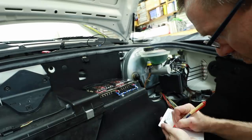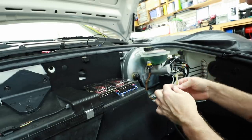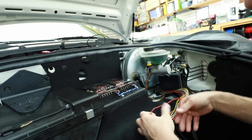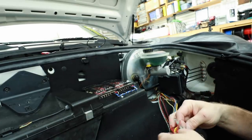Positive. That's the mid-range positive. How this is wired up: there's a fat gray and a skinny gray — that's the driver's door. There's a fat red and a skinny red — that's the passenger door. The rest of the wires are for the rear channels and the center channel. Once the wires are cut, re-tape the factory harness back up.